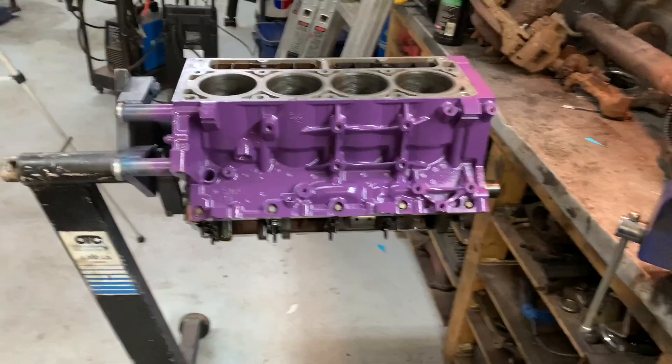Seeing as I've got all the rods and pistons assembled and I've got an hour or so left, I think I'm going to go ahead and stab them in. So this engine is soon going to be done. I think I'm going to have to change the cam plan — the LS7 cam takes a real big spring, it's really aggressive and takes a lot of seat pressure. The springs that match that cam are on back order at the moment and I want to get this thing together. So I'm going to go ahead and put my LS1 cam in, which will be perfectly fine — a little bit more lift, I think it's like 0.500" lift, 0.495", something like that. That'll be perfect for this anyway. The main plan is to get the engine built — the second I get it built and fired, I bring the van up, pull the engine out of it. That's when we'll start the actual fun work: getting the engine out, getting fabrication done, see what kind of problems we're going to run into. I haven't necessarily put this style of engine in this style of vehicle before, but it's going to be some fun. I'm probably going to be asking for a lot of help and tips. So let's go ahead and put these pistons in.